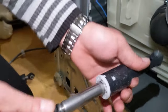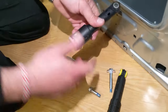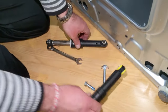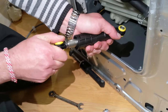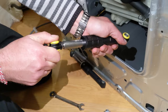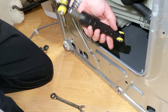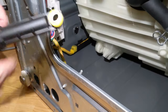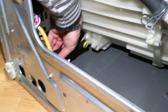This shock is completely shot. Here's the new one — part numbers are matching, just one is yellow and one is white. You can see how hard the new one pushes back compared to the old one. The old one has almost no resistance. They do have some play — that's natural — but the total resistance should be way different.